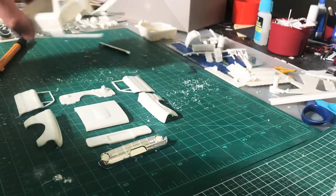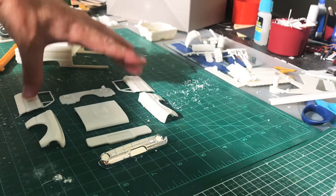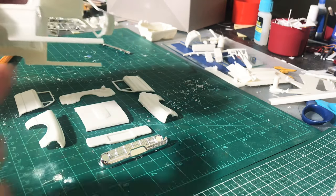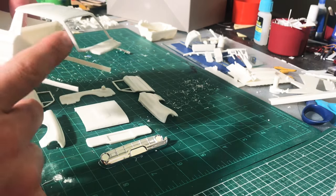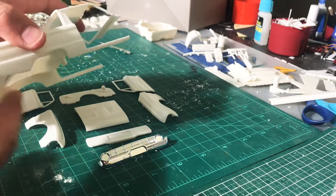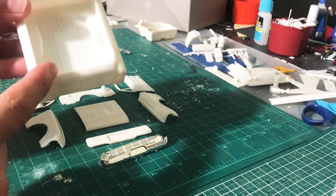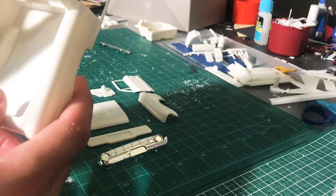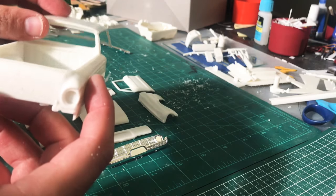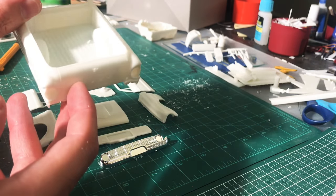So what you can see so far is I've cut the quarter panels out and the doors, and so this is what I'm left with. Right, so you can see the lower rockers, the way the frame comes around, and this beaver panel as well. So what I'll do now is I'll cut the tailgate out, and I'll do a time lapse to show you how that looks, and then that way if you don't need to have a look at it, then you can skip ahead to the end of this video.